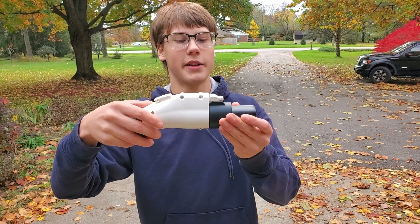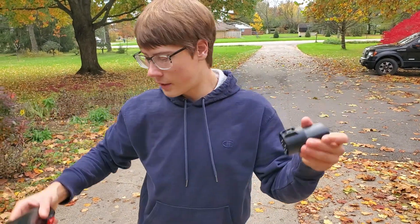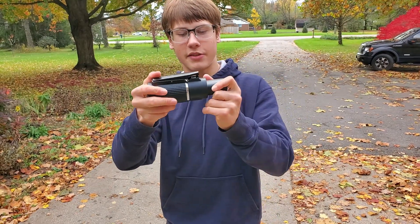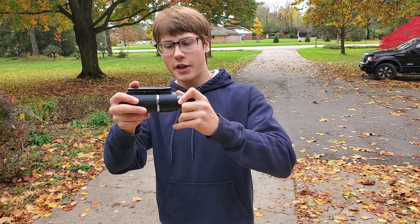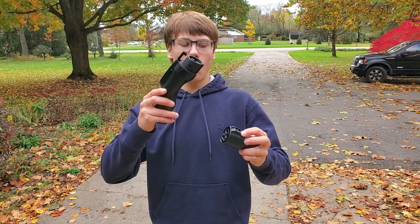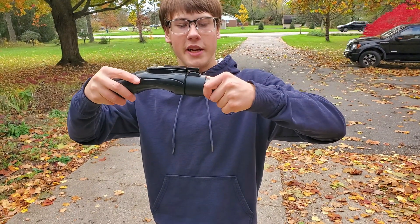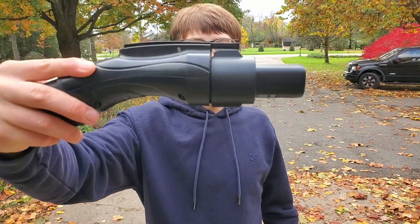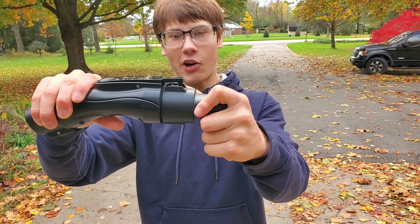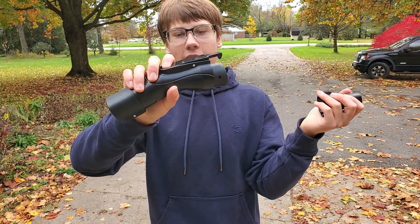Here's what the latch is supposed to look like: when you press down it goes in, you hear it click, and the latch is inside so you can't pull the connector out — you have to release it first. The Alawula adapter fits in perfectly and latches as it should. The other Alawula works fine at 48 amps and clicks in. The Bookman adapter works too, though not quite as smooth as the others. The Orion Motors adapter — other than the one that doesn't work at all — requires the hardest push and has a weak, flimsy latch. It's also the hardest to plug into the charge port, but it still works.